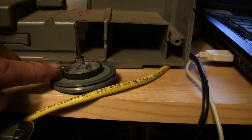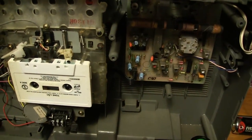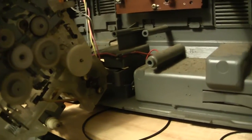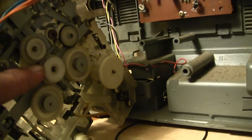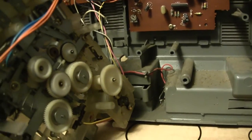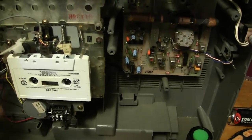While this will still play a cassette, it will not rewind or fast forward terribly well because this rubber tire is no longer there. The little wheels — this one here and this one here — they drive off of the rubber tire, whereas this one here drives off of the little tiny diameter right there. That's what it all does.